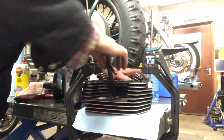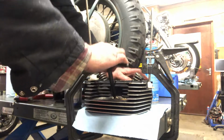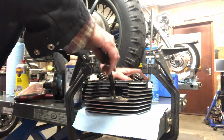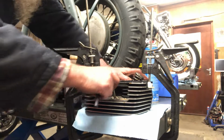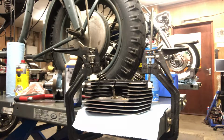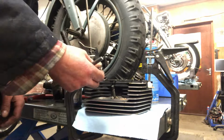It's got a top hole in the bench. Just go in about a quarter of an inch past the top of the hole with a little cutter. That cuts a new chamfer for the insert and a new seat, so everything's square.